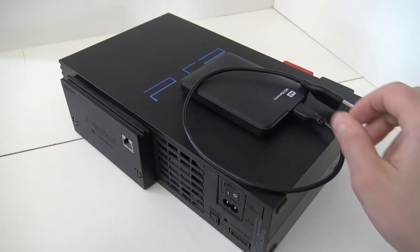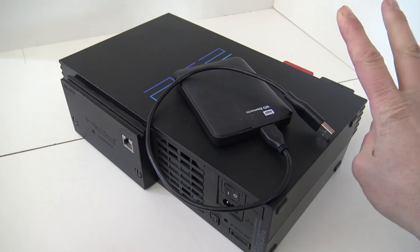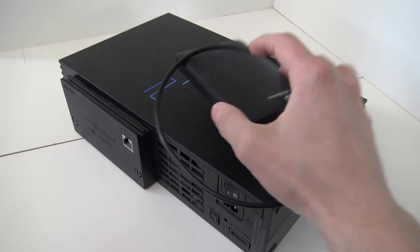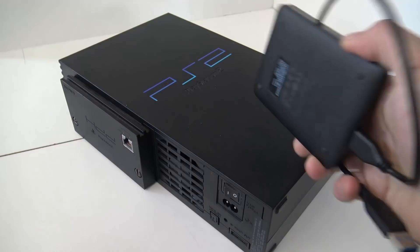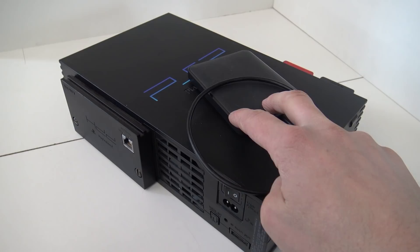As I mentioned earlier, you can use a 2.5-inch USB drive — there are USB connections at the front. But when you have a slim there is no way to add the internal hard drive. Keep in mind when using OPL it's strange: the internal hard disk is supported way better than the external one, and a lot of games are not working when you try to add them on a USB drive. It's a bit of a shame because a USB drive is more convenient to use.